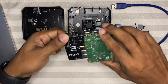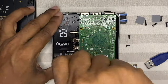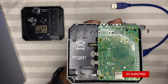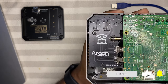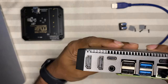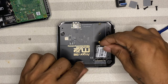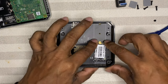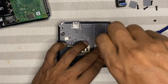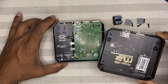Go ahead and put in the four screws following the locations in the manual. Once completed, let's look at the power jumper settings — kept to default so I can use the button located behind to turn the box on and off. Now let's add the M.2 SSD drive to the lower base and insert it into the slot. There's a small screw to secure the SSD drive correctly, and note there is no SD card installed.